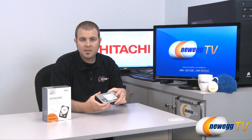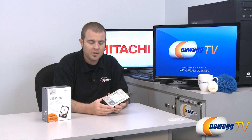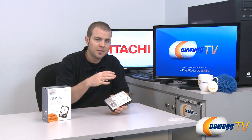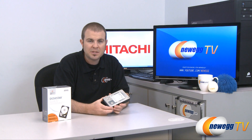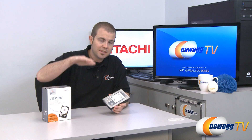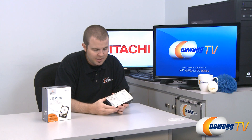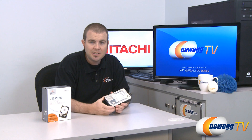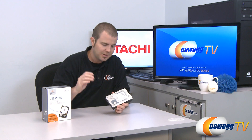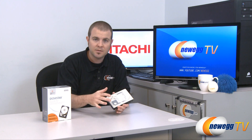This is a three terabyte hard drive, and you may notice that until about four or five months ago three terabyte hard drives were really nowhere to be found on the market. That's not because there's a physical issue with creating hard drives of this capacity — it has a lot more to do with the partition table that has been in use since about the early 80s. That's called MBR, which is Master Boot Record, and essentially it has a cap of two binary terabytes, meaning it cannot partition the hard drive to access more space than that. The replacement for MBR is called GPT, which is a GUID Partition Table, and it will allow you to set up a partition table on the drive that lets you access all of the space.